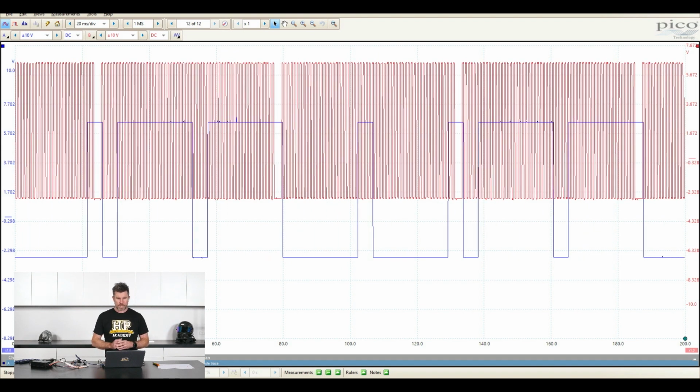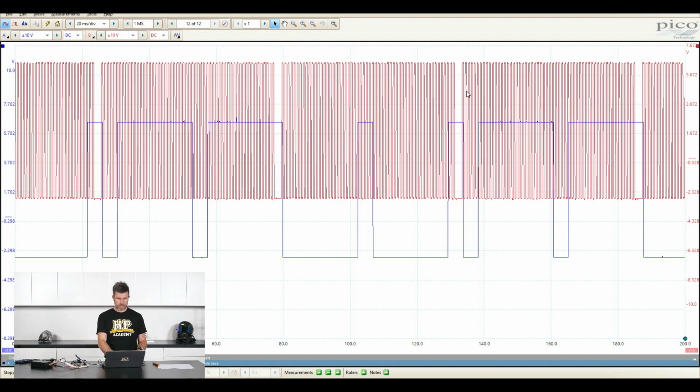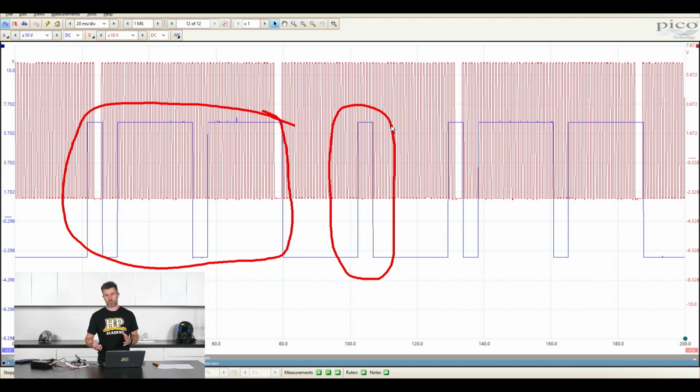And what I'll do just for a moment is pause it, and we can see the signal we've got. So from memory, this is a 60 minus 2. So our trigger B there, our channel B, which is our red, we're going to have basically 60 of these little teeth, and then we're going to have a gap of 2, so 60 minus 2. And then on top of that we've got our trigger pattern for our cam position or synchronization. So it looks like we've got 3 teeth: a short tooth, 2 wide ones, then a gap, then a single tooth, then a gap, and then it repeats.